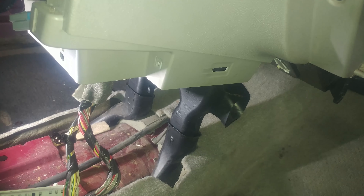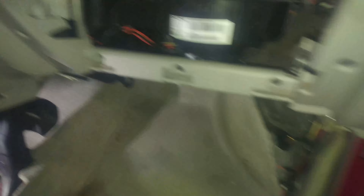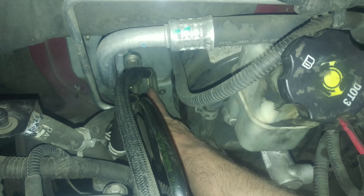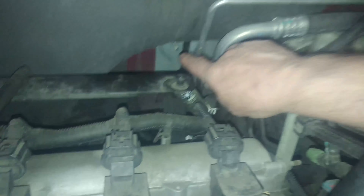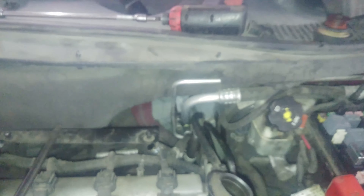This is going back together, but when you're taking it apart to get the dash out, that center piece can come out. Three bolts on this side and three on the other side. There are two studs in here — one on the right side of the heater core and evaporator, and one up on the left. I did another one but it didn't need to be done; that one does not need to be undone. So just those two studs.